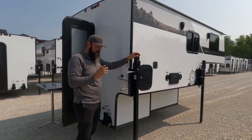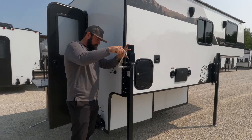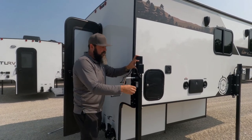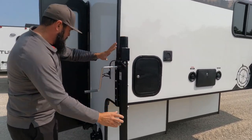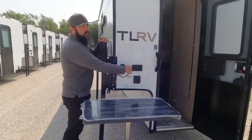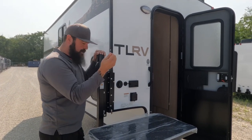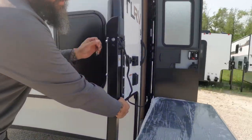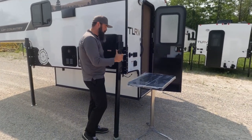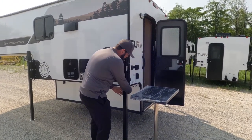In case a jack went bad or you had no power, you can flip this switch, take this crank, and crank those jacks up or down. You do want to disengage them so you're not fighting the power motor — it's quite a bit harder to turn when you don't disengage. This is your disengage switch on the Happy Jacks. A lot of people don't take truck campers off their vehicle once they arrive, so all you'd have to do to leave these jacks at home is unplug and remove the pin, unlatch it, pull it out, and remove the jack. Each jack weighs 35 pounds, so by taking all four off you'll save 140 pounds on the weight of your vehicle, as well as not having them stick down the side of your truck.